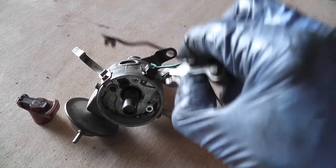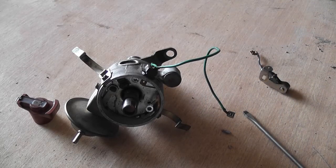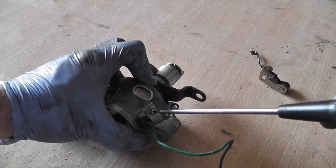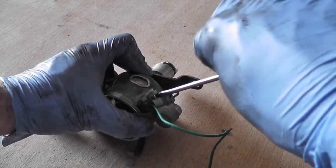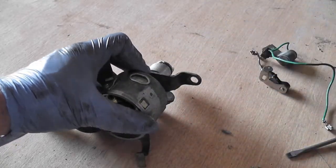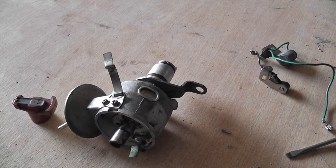Personally I like to install electronic ignition kits in cars. Every modern car has electronic ignition nowadays, and if you buy a decent quality one there's no reason why it should be a particularly prone point of failure. We're also going to take the condenser off — that's this screw on the side. We take that screw out, remove all of this, and we'll go get our new points.